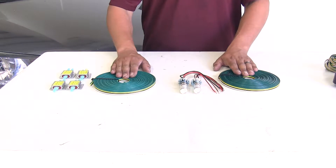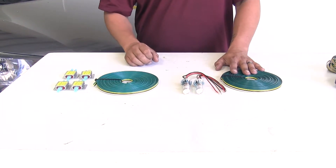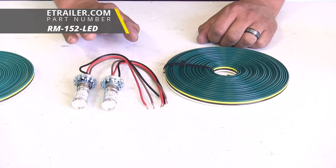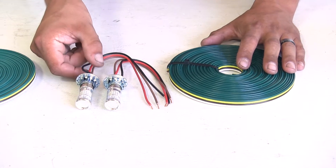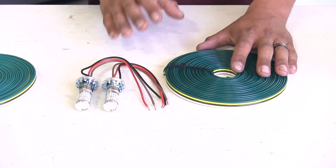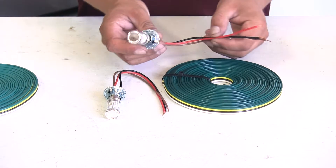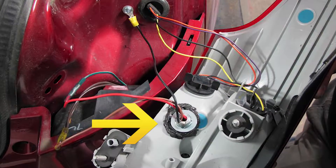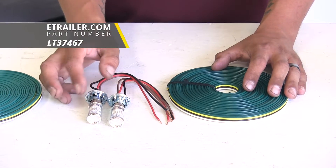Our diodes and bulb and socket are going to be a permanent solution and we're only going to have to install them one time. With our bulb and socket we do have a few different options available, and the biggest thing about these is that it's going to completely bypass our vehicle's electrical system, so we're not going to have to worry about any kind of damage, short circuits, or any back feeding from our motorhome. Keep in mind that we are going to have to drill a hole into the taillight housing in order to get the bulb in place, and because of that we're going to have to make sure that we seal it up really well, typically using some silicone or other kind of sealant.